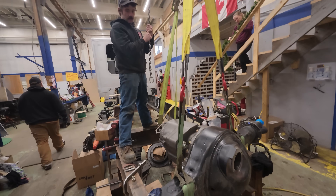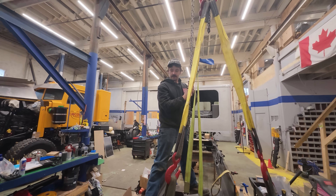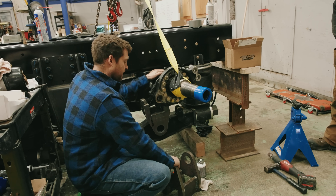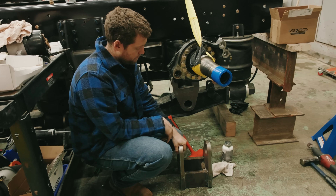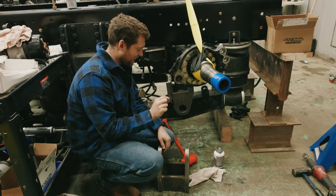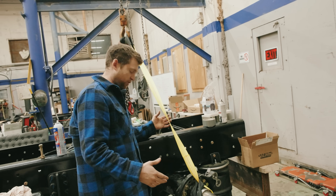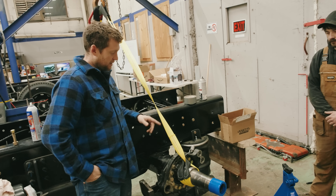We've dropped in the third member to the housing, got it all prepped up, cut the mounts off, and we're going to fit it under the truck to see how everything fits. We got the new Meritor axles in and resolved the issue by sourcing another Meritor axle that was in stock at the local place. We got the axle hangers, but there was an issue — a bit of a hold-up with the tolerance. We obviously designed this, but for some reason engineers love to make things fit exact, to the point where we've got to grind it down a little bit. Tolerances are so important when it comes to actually building things in the real world. What works on a CAD model doesn't always work in real world, because when you weld the plate up, the heat warps it a little bit — you need to leave a little bit of room. So Jordy's been grinding them down here to make them fit.